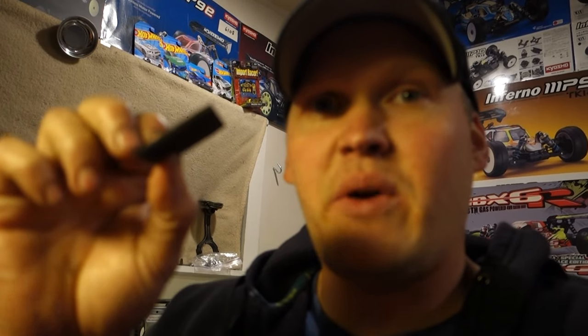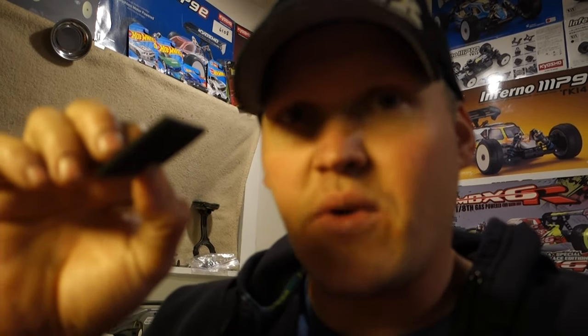But yeah, I don't bolt it down tight. I make sure the screws are long enough that they'll kind of bottom out, but don't bust your case or anything, and have this pad in there. That way, if you have an impact, if it gets rocked forward, it has some give to it. Because these cars go through some stuff, say you come up short or you case a jump. It takes a toll on stuff.